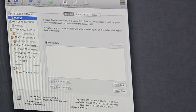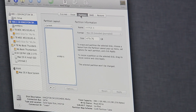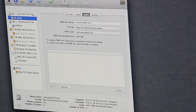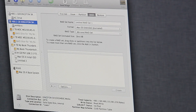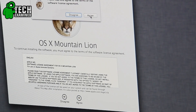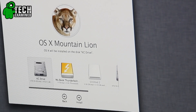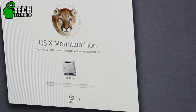With a quick setup, I didn't do any partitions on the KC drive or the HyperX because I didn't find the need right now, but you could run Windows 7 or Windows 8 on one side if you wanted. I was going to RAID these together to see how fast they'd go, but if you lose a drive you lose everything, so I held off. Once we get everything formatted, I picked the KC drive — the more business-robust one — to put Mountain Lion on, and then we test it out and see how fast it goes.